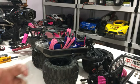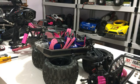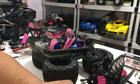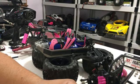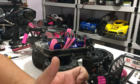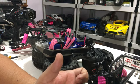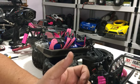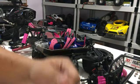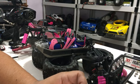Me making something like that at the store and me totally cracking into that are two different things. Let me tell you the things that I've already bought for that. I've bought aftermarket decals. I've bought a brand new servo for it. Stainless steel screw kit I already acquired for it. The servo is the main thing that I want to change out immediately. I'll drive it with the 2075X, but I definitely am changing out for a stronger servo. I'm probably going to need a capacitor on there depending on how it works out. I already have two brand new batteries from Traxxas waiting for me to install in there.